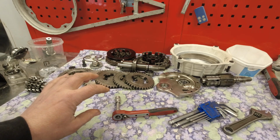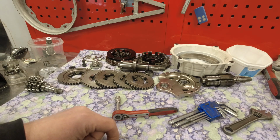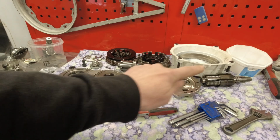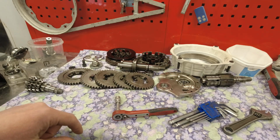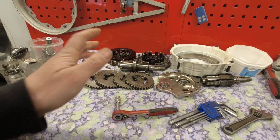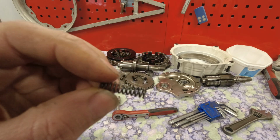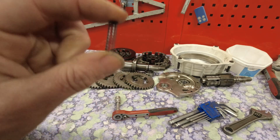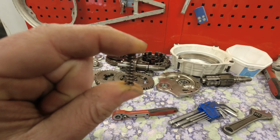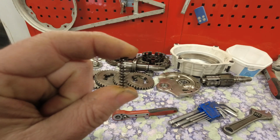There's a couple of reasons for that. The biggest one being safety, and the second one being I had some fitment issues with the original Series 1 type, which is over there. Now, another thing as well, I had to strip this gearbox anyway, because for some really strange, weird and wonderful reason, he'd fit this spring. Now, if you've had a spring out of a lay shaft, you will know that they are quite a lot longer than this normally. But this is short.